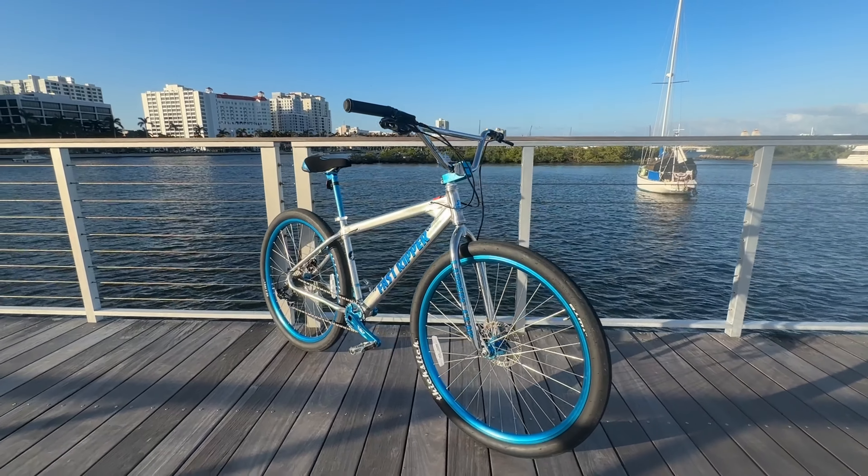Further down the line, for someone who wants to put some money into this bike, I'd change the hubs and put some aftermarket hubs — I like the Hope Tech hubs. The engagement on those is pretty loud and good, because the stock hubs have a little bit of lag play before you even hit the pedal. I'd also change the seat clamp because these are known for bending, especially if you tighten them too much. And if you don't like metal pedals, go ahead and slap some plastic pedals on there as well.